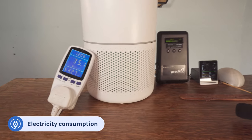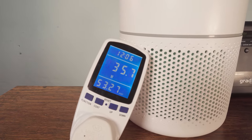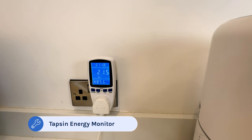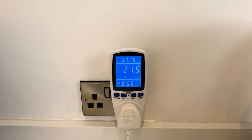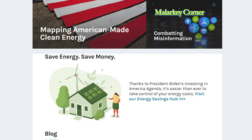The last step is the energy consumption test. When buying an air purifier most people focus on its initial price without considering the long-term costs. One of the most important long-term costs to consider is electricity usage. To calculate energy consumption, we plug the air purifier through an energy meter, turn it on, and track the energy consumed at the lowest and highest fan speeds. With this data we can estimate what the electricity bill is likely to cost you, with the help of a calculator from the US Department of Energy.